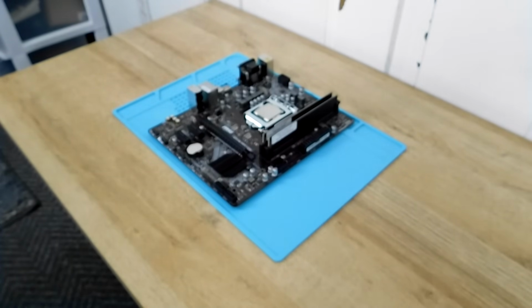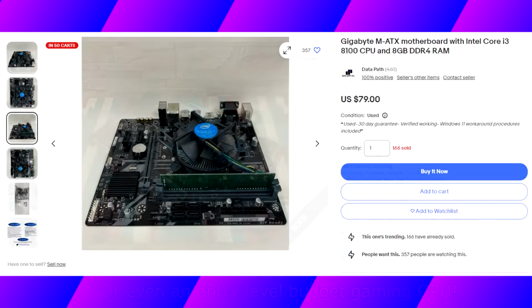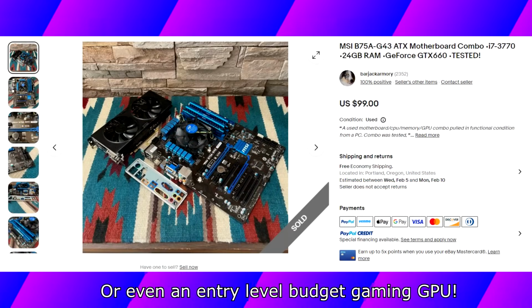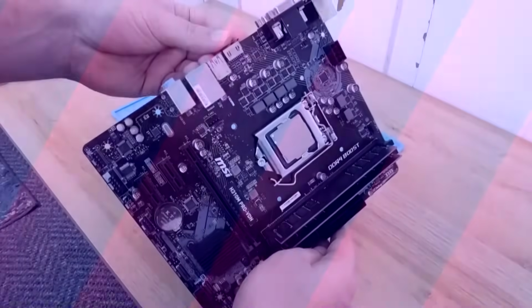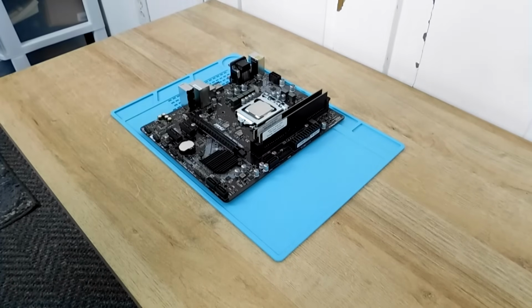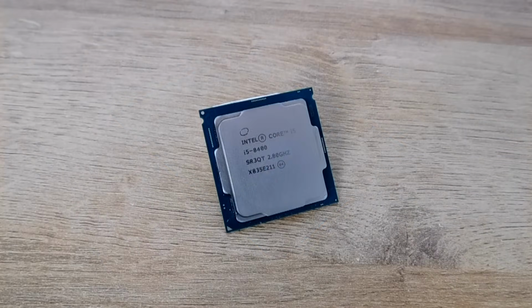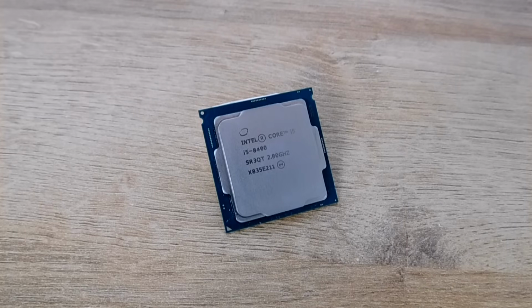Or maybe bundled with, I don't know. Believe it or not, it isn't that crazy for you to get RAM in these motherboard CPU combos, or other components like storage for that matter, when you buy these online or in person. In a weird way, this was a trade-off because usually instead of RAM, you are given a CPU cooler already mounted and whatnot, leaving you to just getting RAM or an M.2 to complete almost the main board assembly section of these sort of budget builds. But this is an opportunity for a learning moment in cost-saving exercise. Remember how I mentioned our CPU only has a TDP of only 65 watts?